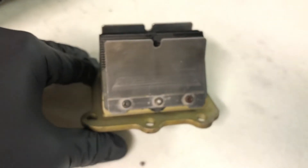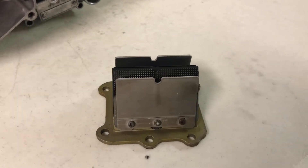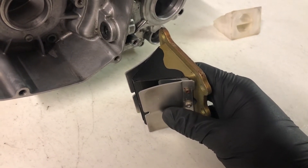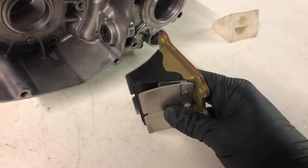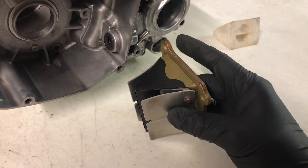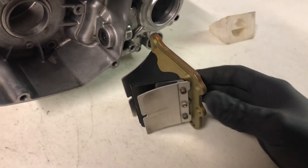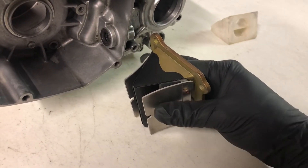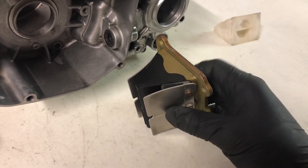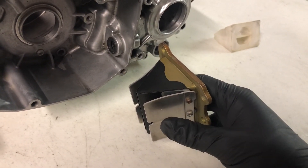But I'm going for maximum performance on this engine, so I'm not going to be flipping them around — I'm just going to replace them with some aftermarket flaps. One really interesting thing about a reed valve is that it actually opens and closes almost to a one-to-one ratio with the engine, so these things open and close extremely fast. If you're doing 8,000 RPMs with your engine, these things are going to open 8,000 times a minute, so they can wear out just because they're used so heavily. A reason to go to aftermarket reed valves is that it'll vaporize the fuel more into the engine and they'll also be more durable, hold open a little bit longer, and seal a little bit better.